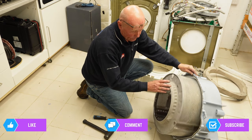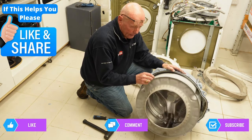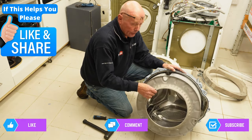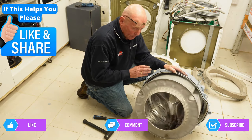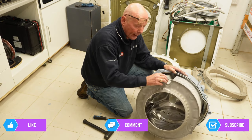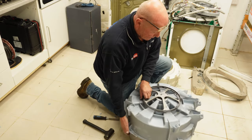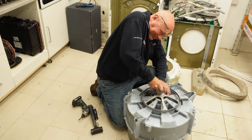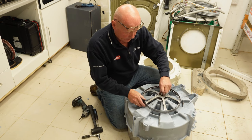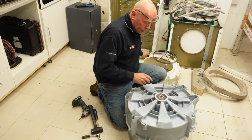This drum looks like it would need replacing anyway — you can see it now has damage and a slight non-circular movement, there's a bit of oval in it. This is most probably because the spider has been gone so many times and it was this edge that would have been hitting the cabinet — and because there's no calcium on here you can see where it was rubbing. I just have to rotate this over now and take off the pulley wheel. These bolts are held in with Loctite on the pulley wheel — the pulley wheel comes away, and that's also a useful part.